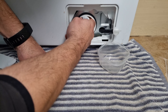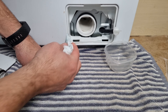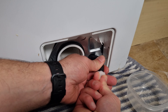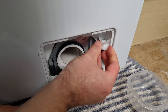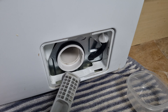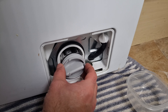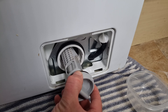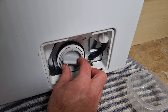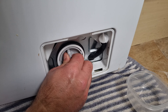Okay, so that's pretty much it — I'm going to put it all back together now. I'm going to screw the filter back in tightly all the way, then position it so it clamps in just there. For the drain tube, you have to make sure it only goes in one way — if you do it wrong it will get stuck, so just rotate it until it slides in. Then turn it clockwise a few times to seal it nice and tight.